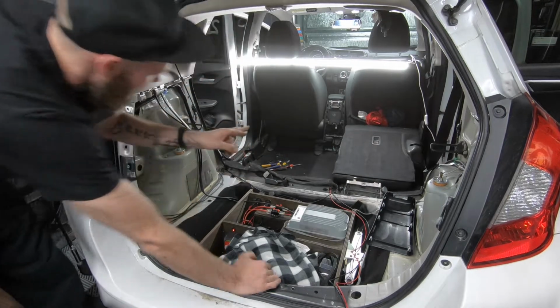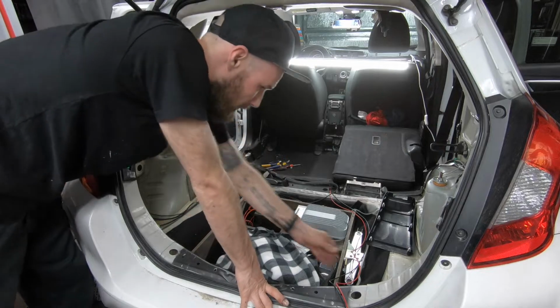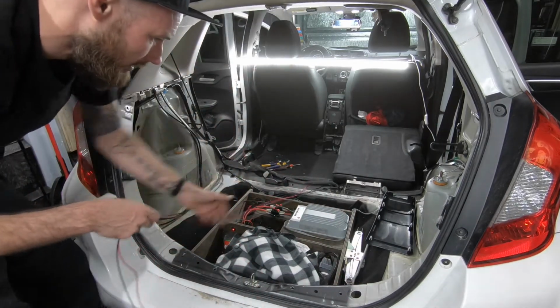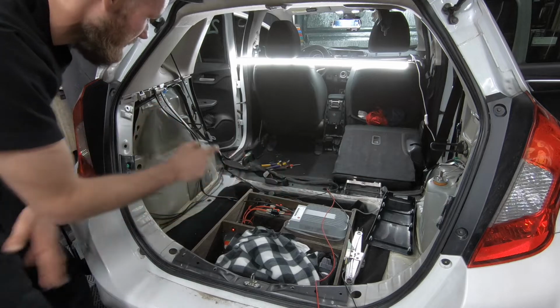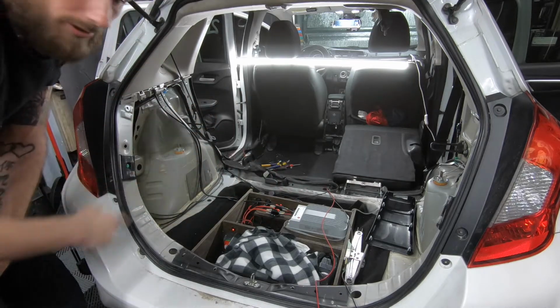I took off the center console just a little bit, ran it under the carpet, popped it out in the back. Here we got our power cables, and now I'm gonna run it to the fuse panel in the solar box, and then at least put the back side panels in. I'm still gonna leave the front panels off up front so I can still wire the switch in.